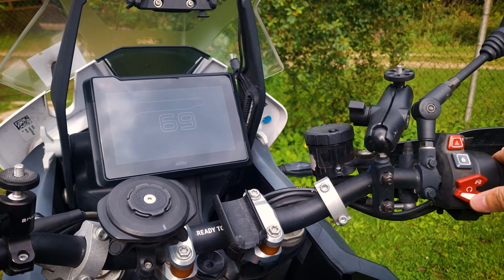Taking all the plastic apart and trying to get to the pump. There are a wide variety of bolts used in this bike. They are different lengths, diameters, and slots. There are bolts that have different size spacers for the plastic, where it clamps two layers of plastic and where it clamps one layer of plastic. This has to be taken into account, and it is advisable to somehow stack the bolts so that you can find and screw them back in afterwards.